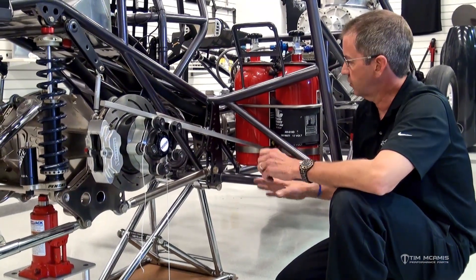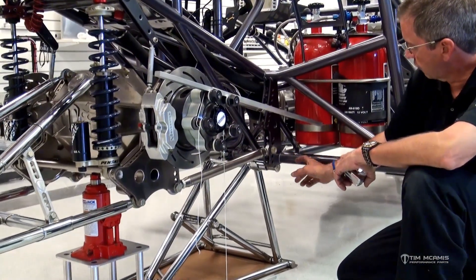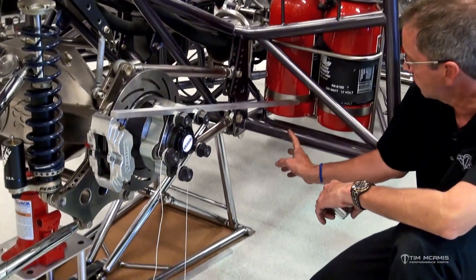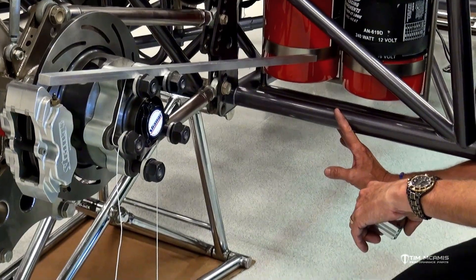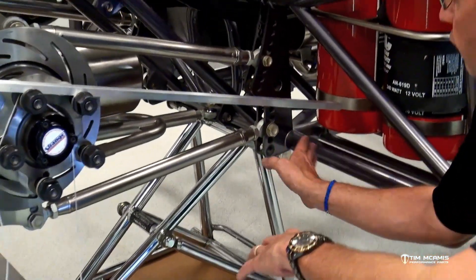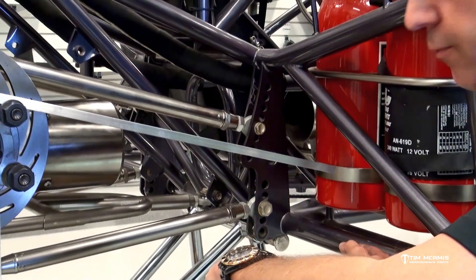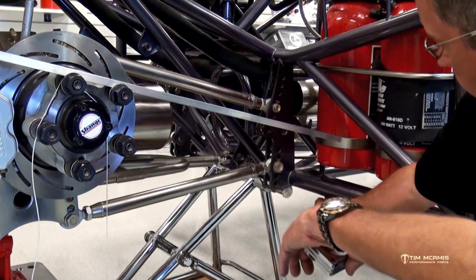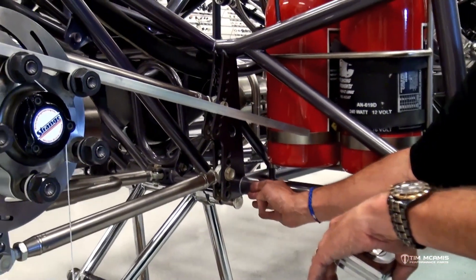I'm going to name a few of these parts just in case you don't know them, so you can reference what we're talking about in the video. This is the rear cross member. It's the first tube that goes down on the chassis table when you build this car — it's kind of like the foundation of the house. This is part number one, what we're going to reference to. This tube is straight across the back of the car, it's parallel, square with everything in the car. For rear end alignment, we want to reference the back side of this cross member. For ride height, we reference the bottom.